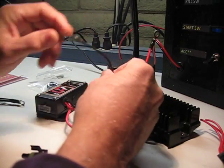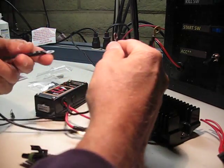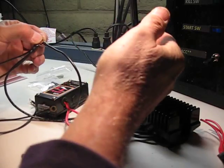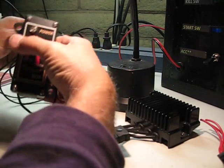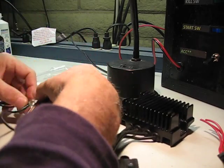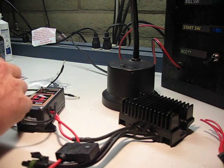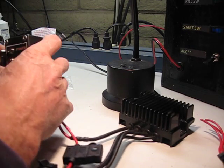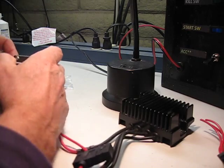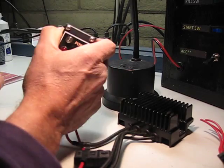The other wire here looks very much like a ground, and that's in fact what it is. When you install this, you're going to be finding a mounting bolt. I'll just grab one of these bolts right here so we can see what's happening a little easier. I'd put this through, come through my single point ground, and then mount that to the upper corner. It's just as convenient. You could have put it on any other mounting hole.